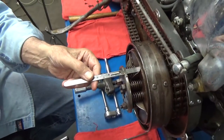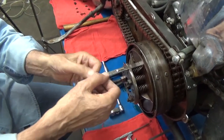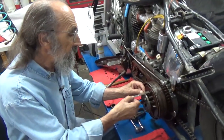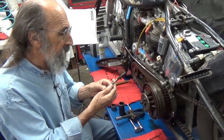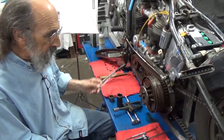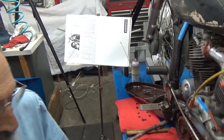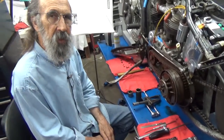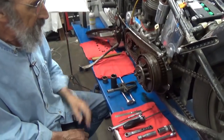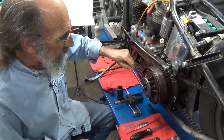I set one of these little adjustable rules so I know where this thing was set last time. The book recommends an inch right here from the pressure plate to the releasing disc. It's a little over an inch - the later ones are an inch and a 32nd. Numbers like that in the book are a good starting place when you've got a bunch of worn stuff. It may work and it may not - you may put it together and the clutch will slip and you'll need to increase the tension of the springs.